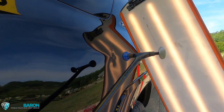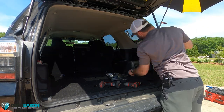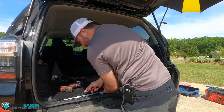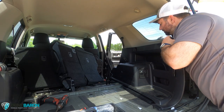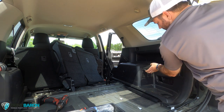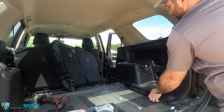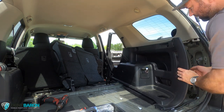You can see it's coming out. Since there's relatively no access through the taillight — the interior trim panel has a bulge in it — I'm going to take the interior trim panel out. The only way to do that is to take the rear seats out and the floor carpeting. Mobile Tech RX says there is access through that taillight, maybe six inches, and also through the striker through the door. I'm here to tell you that is not going to happen on this vehicle, and I'll show you why in a moment.